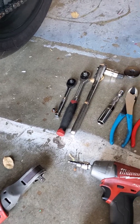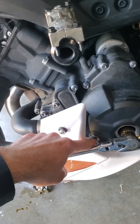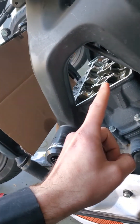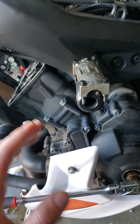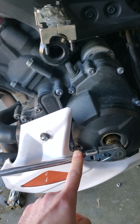These are the various tools that you will need. That half-inch ratchet will be to remove that cap, which is located on the left side of the engine. Remove this access port and you'll see if it's at the dash mark, which is top dead center, which is what you'll use to get your valve clearance measurements. And then when you're going to disassemble everything, make sure you go ahead and set it to 125 degrees before top dead center, which is the triangle mark we'll show here.